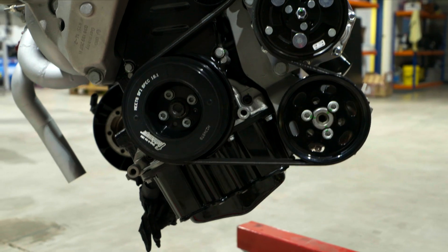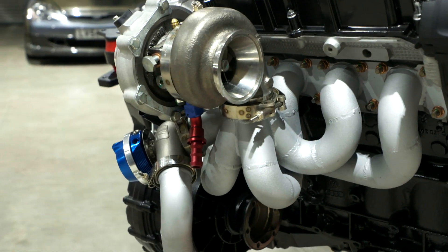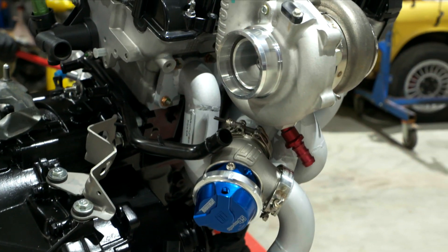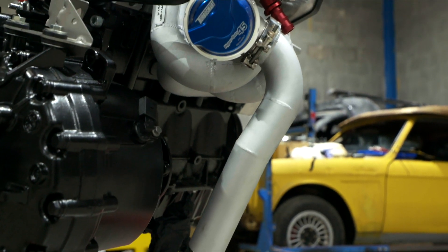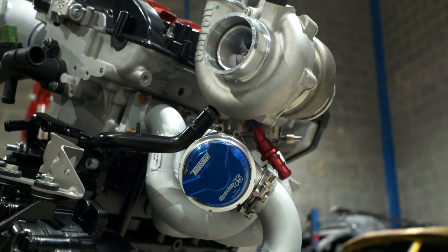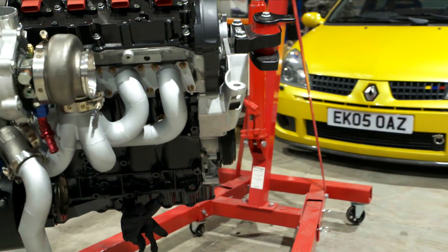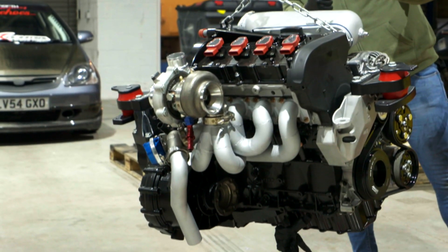We have a Garrett G25 550 turbo, which is one of the latest V-band turbos and is a purpose-built competition turbo, unveiled at SEMA in 2017. We've opted for a 3-inch exhaust system with a ceramic-coated tubular manifold with a large port runner. The turbocharger, manifold, and turbo lines are all stainless steel braided. Gravitune Power have provided the intake manifold with large runners, CNC trumpets, and high-volume tapered plenum. R32 3-inch throttle body and gas-flowed large port head. We've fitted a 45mm turbo smart wastegate with a 50mm race port blow-off valve. The screamer pipe will shoot flames out of the car, which is really important to show how big the power is.